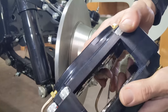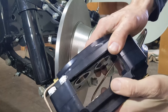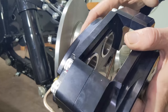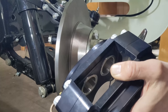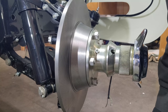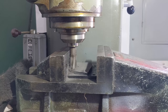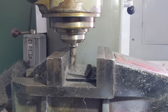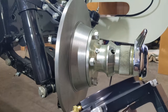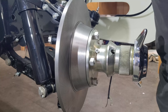Time to do the front brakes. I'm putting on these big four-pot calipers — I know this kind of goes against what I was saying about keeping the car original, but this is what the customer wanted and I'm not building this car for myself. I think this is one of the very best upgrades if you're going to upgrade an XK. When I tried to fit these two episodes ago there was a discrepancy — I wasn't able to center them. What I did was put the pads in the milling machine and very accurately took off the required amount. Frank at S&G Barrett was a lot of help — he didn't want me machining the inside surface of the caliper, I didn't want to machine the car, so the only thing left was to do the pads and take them down a few thousandths. I think it's a great solution.